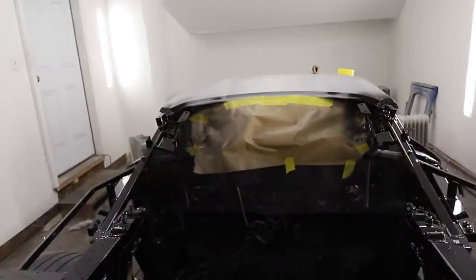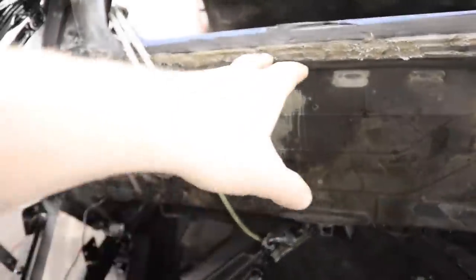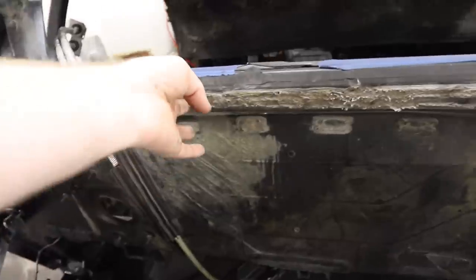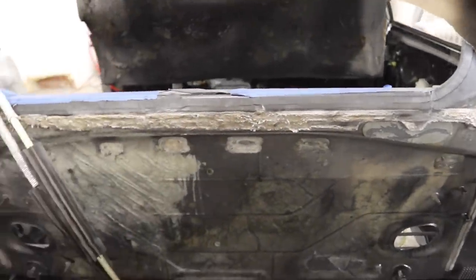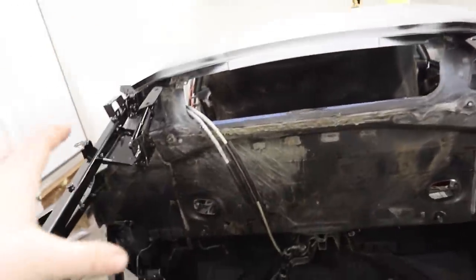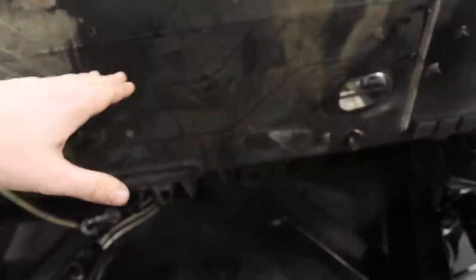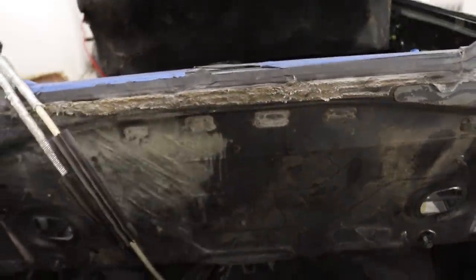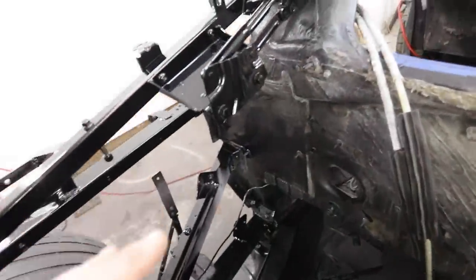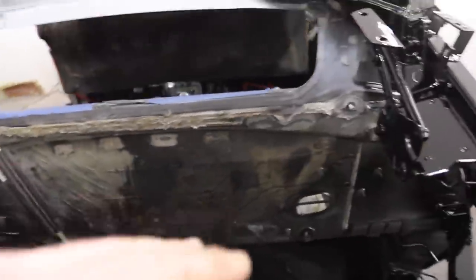The ugly spot is basically back here where we had some fire damage. We repaired our firewall by adding more resin and fiberglass — this is all just seam sealer, and although it is a little bit burnt, the surface is bad but it's still doing its job. Rather than grinding it all off and risking adhesion issues, we designed the car so the reservoir covers this back section, and a back padding that comes all the way up here gets installed tomorrow. At this stage I'm just going to hit a bunch of stuff with flat black so it all looks nice and uniform.